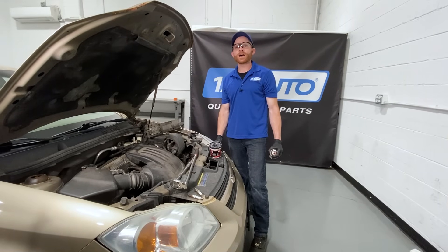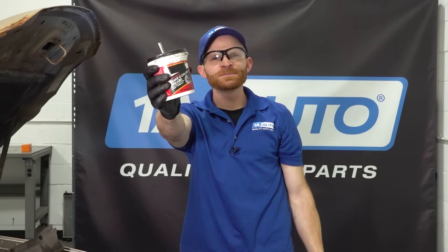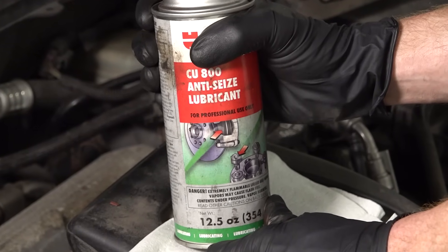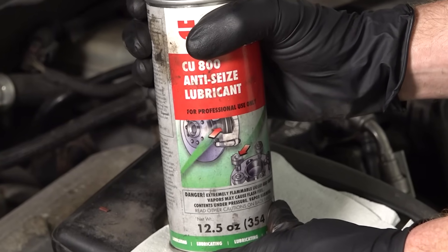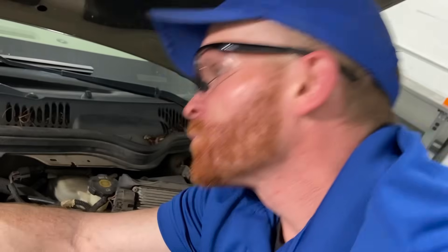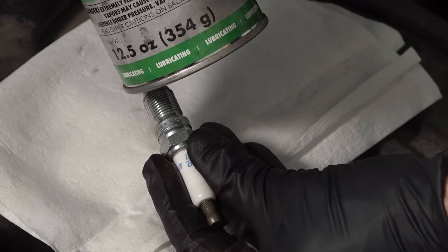The next couple things involve installation mistakes. We're going to talk about using some sort of lubricant, whether it's a copper never-seize or even some type of paste. Why might somebody try to use copper never-seize when doing spark plugs? Sometimes when you're doing spark plugs on a vehicle, they might seem kind of stuck — frozen in the engine. When you try to break those free, you might try to put a whole bunch of pressure on it. So when you put in your brand new spark plugs, you want to make it a little bit easier for next time — let's try a little bit of copper never-seize.